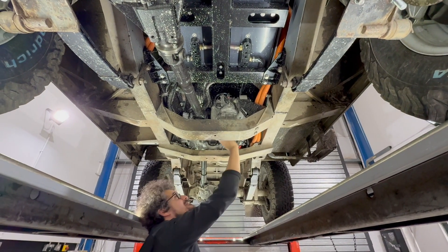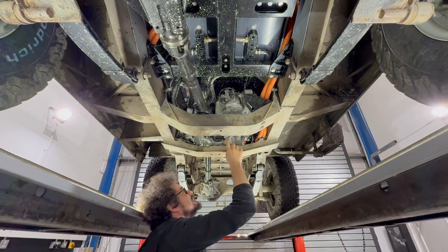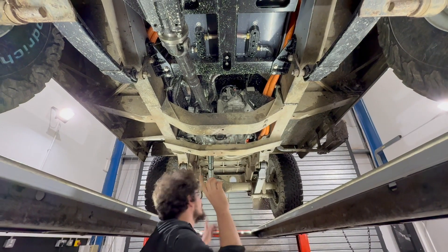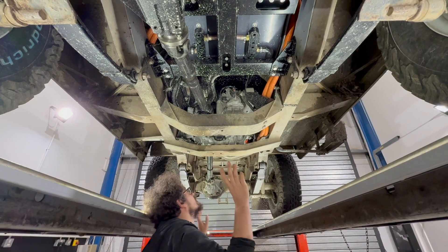In the middle here you've got the Tesla Model 3 rear drive unit. This has got a Quaife LSD in it. It's got a brand new gear set which matches the ratios of these Defender Axles, so you get the right finishing speed.